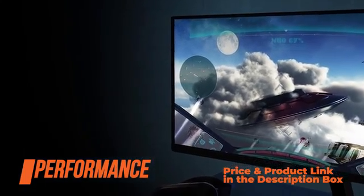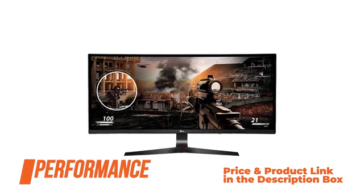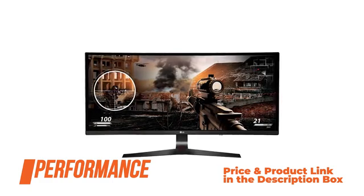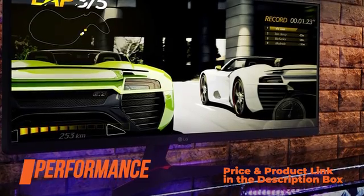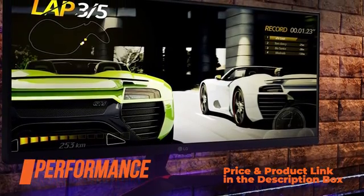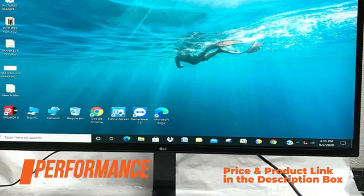This monitor also supports AMD FreeSync with a 40 to 75Hz variable refresh rate range. As long as your FPS is somewhere between 40 and 75, the monitor will adjust its refresh rate dynamically, thus completely eliminating screen tearing and stuttering without introducing noticeable input lag.